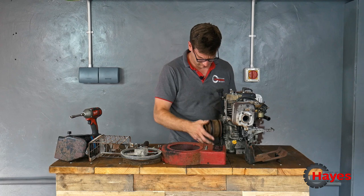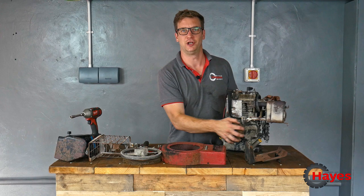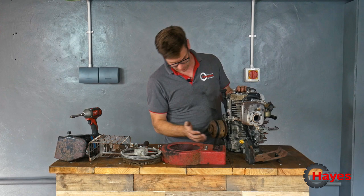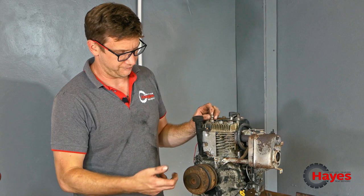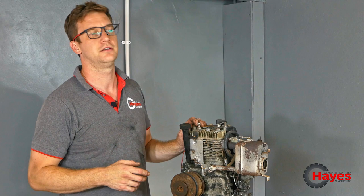We've taken the majority of it off. We're going to try and take our pulley off — it's got some grub screws in some deep dark holes on there holding that on. We're probably going to need to get our air hammer. Love a bit of air hammer to get that pulley off. It's been fairly well on there — because if the engine was changed in around '97, that's been on there 20-plus years. So we'll undo that and get the air hammer on it, should just walk it off. If not, good old oxy-acetylene will warm it up and pull it off.